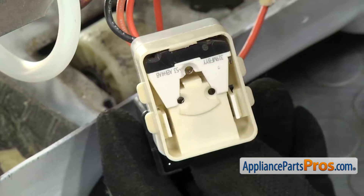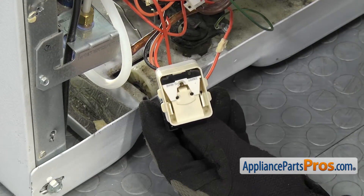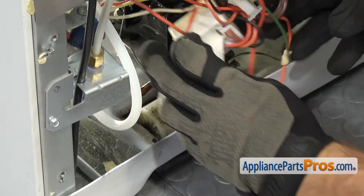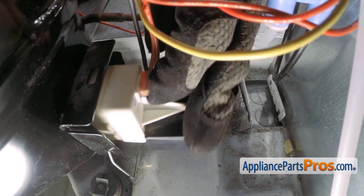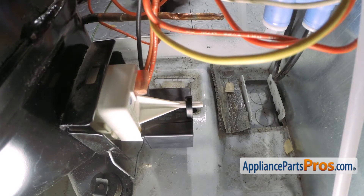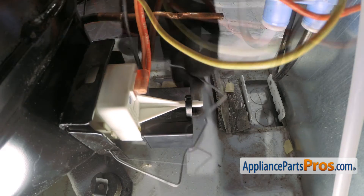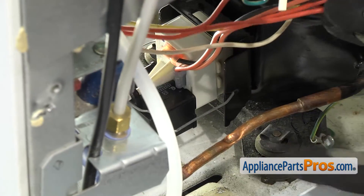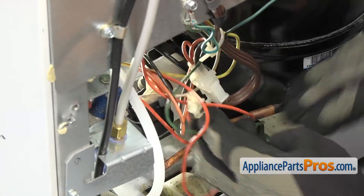When you're pushing it onto the compressor, you want to make sure that the holes are oriented like this, with the overload on the top, so it slides onto the pins properly. Once you're ready to put it on, we can get all the wires out of the way and put it onto the compressor. Once you have it mounted securely, we can grab the wire and wrap it around. Once you have the wire secured to the compressor, you can push the wires back into place — make sure they're not tangled around this copper tubing.